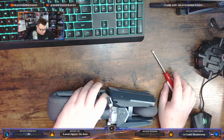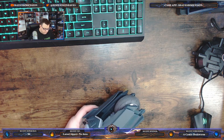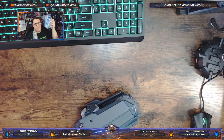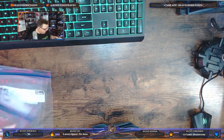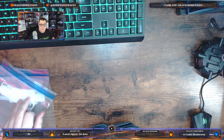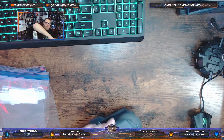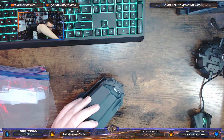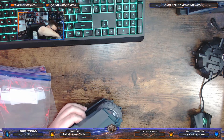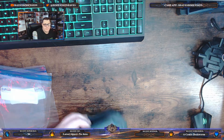First things first, we have to take it apart. We have screws on both sides — I'm going to presume these are Phillips. Before you get to work, Ziploc bags are great for putting your parts in. If you can get ones where you can label them, great — if not, get some masking tape or painter's tape and a black Sharpie so you can label each one. I just started unscrewing this — it looks like we just have two screws here. Be careful: if you feel like you're having to force it, that's not a good sign.